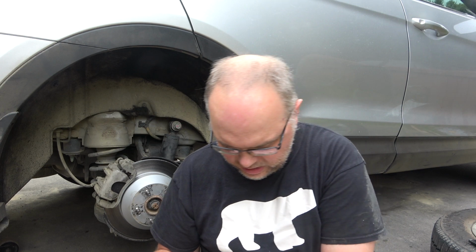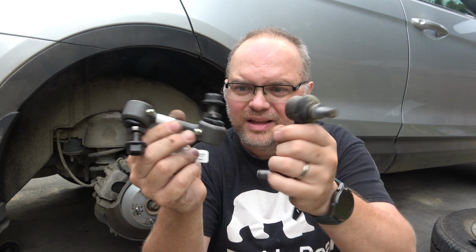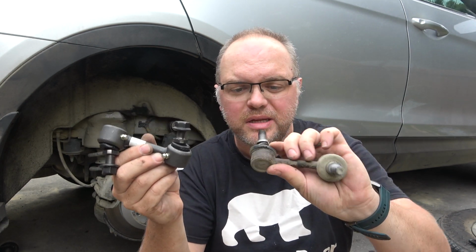But yeah, I'll show you the parts on the car, we'll go and do the other side and go from there. So for replacements, I've got a Moog part. Moog sponsored the NASCAR, so we've got NASCAR parts for our Santa Fe. So this is a replacement. It's one of the Problem Solver I, so it comes with Zerk fittings, grease fittings, so they're greasable, which means they should last a bit longer. And in fact the boots are a lot less exposed as well, so hopefully that means less prone to this impact damage that this one's suffered from.